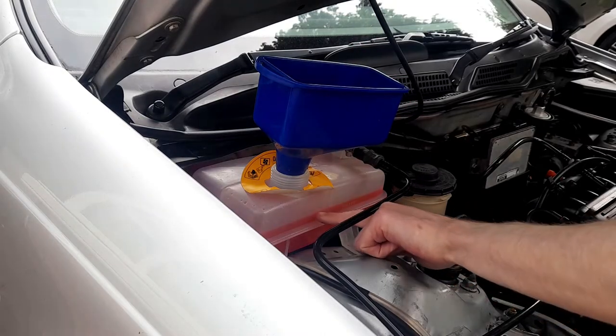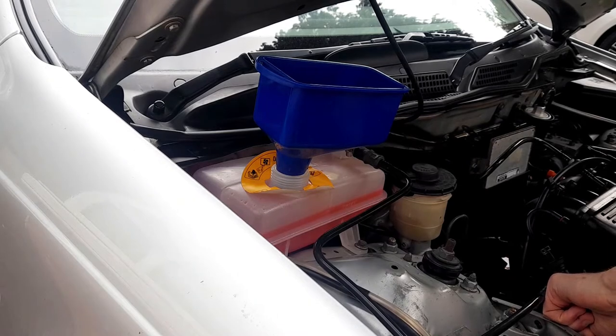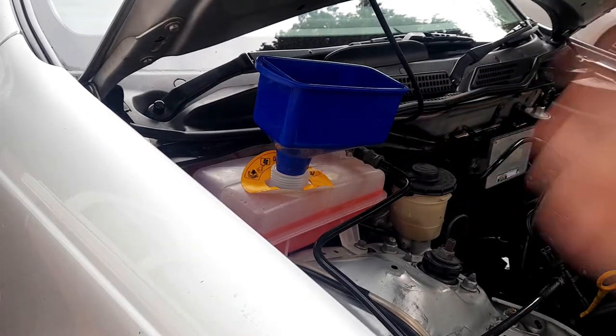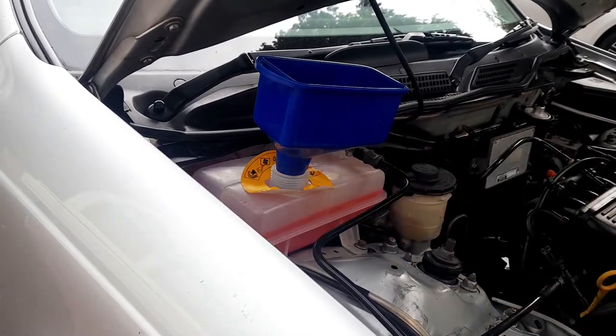And immediately the air bubbles come down, and I've just heard the valve, that little ball bearing inside the inlet manifold. I just heard the check. That little ball bearing is like a check valve. I've just heard it shake. That's exactly what you want to see. And there were just some bubbles coming up to the surface, but all good so far, all clean.